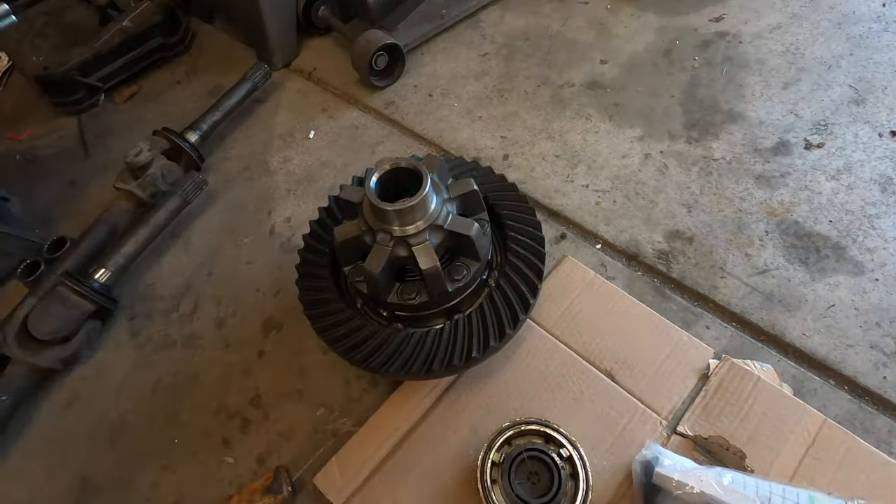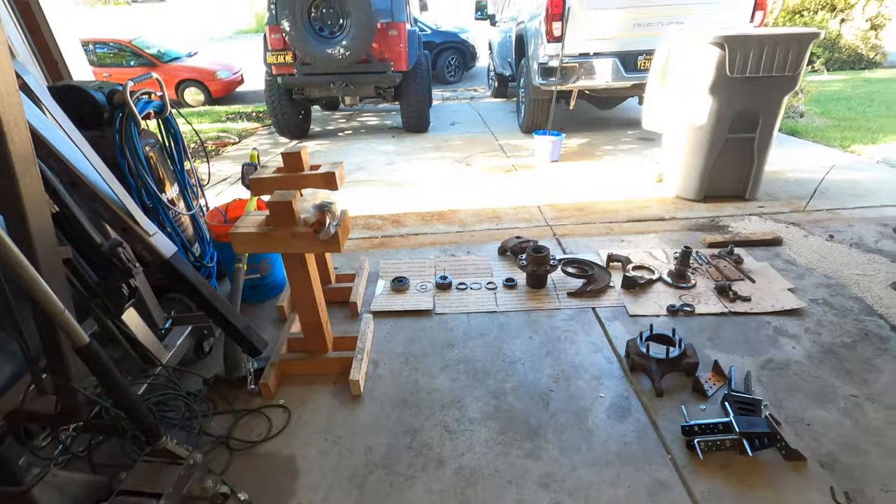Got this baby torqued down — Corbin just pulled it up and we're getting ready to set some gears. It took a couple months to get this thing back and I still don't know if it's going to work, but we're going to throw it in the Dana 70 and see. I have a feeling it's still going to need a lot of shims even though it has almost 3/16ths of a spacer in it. And another issue is the ring gear is probably going to touch the housing because it's pushed over a little bit more — we'll see.